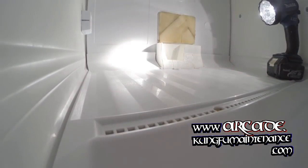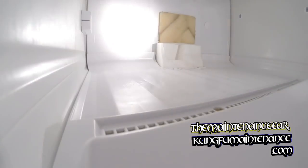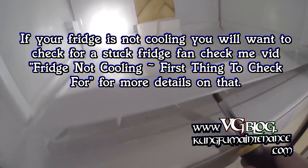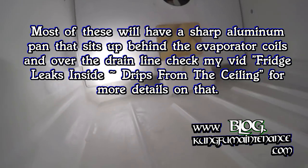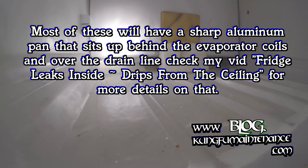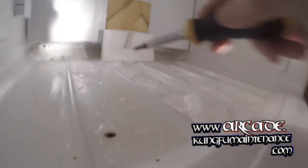I'm going to lift this part up and pull it forward. There's a piece of styrofoam back there — we want to be careful of that. Now we've got our tray right here. On the tray we can lift up — I may need to get my flat blade screwdriver. A six-in-one works great for this. We should feel a bunch of ice underneath, which we did. This is probably totally frozen, so we're going to need to chip all this ice out. I've got a bigger screwdriver head to make this easier.